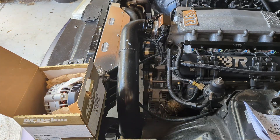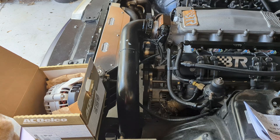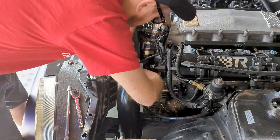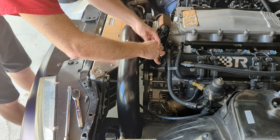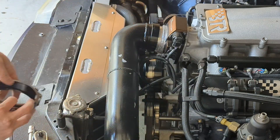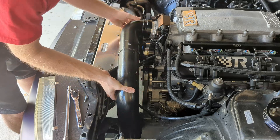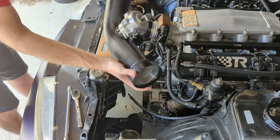What we need to do first in my instance is get the intake tube off running from the intercooler, and then we'll start taking everything else off. For my car it's pretty simple — I've got a 10-millimeter holding this pipe down. From there I've got these Vibrant clamps that just come right off. I don't know if you've ever seen these Vibrant HD clamps, but there's just a pin — push that down — no extra parts, super simple. Love these. There's a second one down here too.